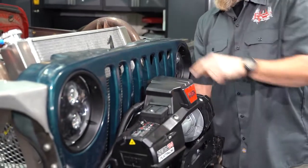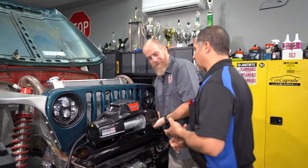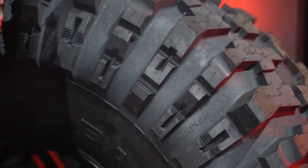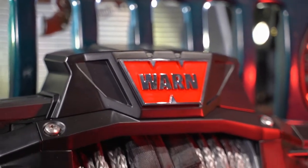That's also why it was important to get that giant Flex-A-Light in there — a giant fan that's going to work. The shroud came off the surface of the radiator so much because the motor is so powerful and it's big. So we know we've got plenty of cooling with that Flex-A-Light setup. We'll probably come in here and give ourselves a little shroud to keep the air from escaping. Very smart.